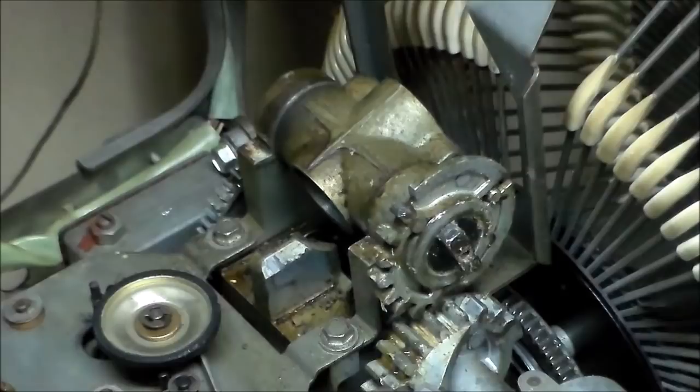Okay, now that next gear, you have to be very careful. I'm gonna take you down there so you can see what it looks like. I can't pound this one off because of where, see how there's a flat spot? Right there, it won't come this way because it's going to hit the gear, right? So there might be a better way to do it, but the way I do it is, again, you turn the motor until you clear that little thing. So see, right there it would come off, right? So now it can slide off because that flat blade is not behind the other thing.